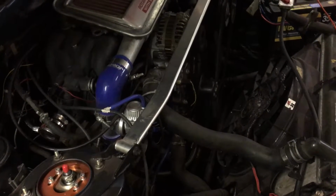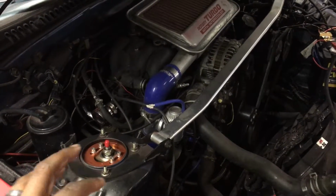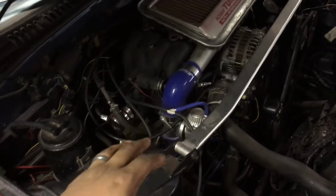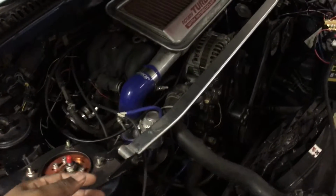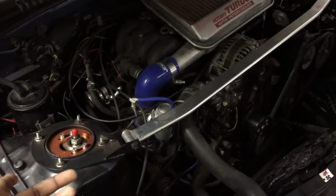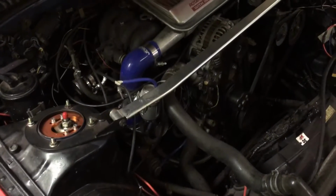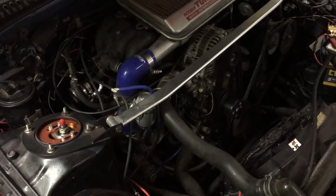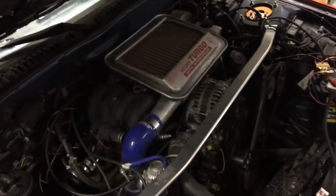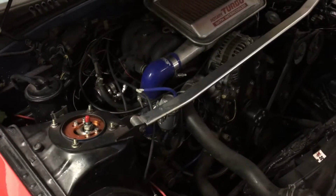I built it about 3 months ago, or 2 months ago, something like that. So what you have is new irons. Your front, intermediate, and rear plates and housings are actually new. I bought those from Mile High Tricks. My actual rotor housings, front and rear, were reused from my previous build, which was an S5 Turbo 2 engine, which I took to the Freelance Auto Motorsports guys to resurface. They did a great job. I wanted to get really good compression on this motor, so I did that. It came out looking almost like new. Very good.